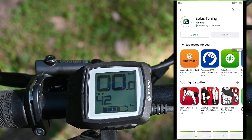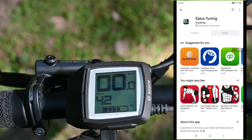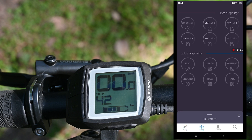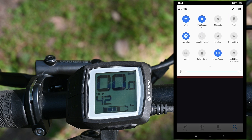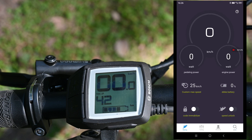If you have the advanced chip, you can activate it this way a few times, but eventually it will say 0.2 and it won't activate. The reason is you need to activate it through the application once before using it continually as normal. Download the E-Plus tuning application, open it, and ensure your Bluetooth, location services and Wi-Fi are all on. Then scan to find the chip — here you can see RN4678, which is our chip — and we're connected.